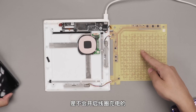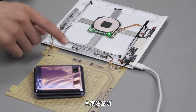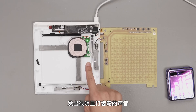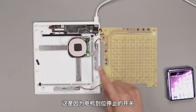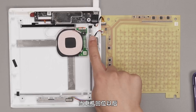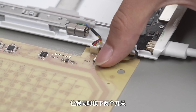Place the phone on the tracking board again and drag the coils. Listen to this — when the coils return, the motor keeps spinning for a couple of seconds making a clicking noise. That's because the return stopping switch is on the tracking board and can be triggered now. There is one stopping switch for each motor. When it returns, the plastic piece will hit the switch. I'll press the switches down simultaneously — both motors stop. If only one is pressed, the other keeps spinning.